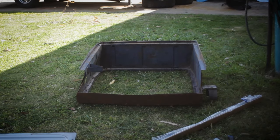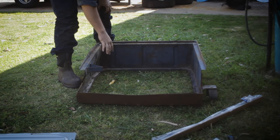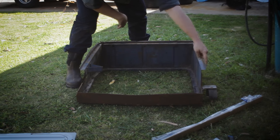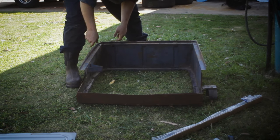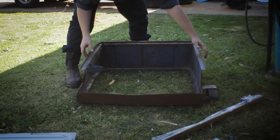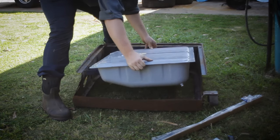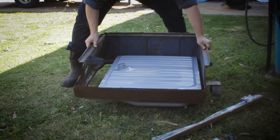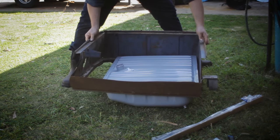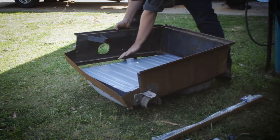The window and window winder - everything's back into this door skin. One of the few replacement parts that the stocking actually came with generously is this original rust-free panel - a petrol tank tub. The petrol tank sits in here on the Falcon, all rusted out along the bottom but still good along the top. It can be cut out of the other car and then this one welded in. I just got the petrol tank out of the box - let's see how it fits into the Falcon. Oh yeah, beauty! It leaves a little bit of space along one side, and the filler neck can actually be routed through there.